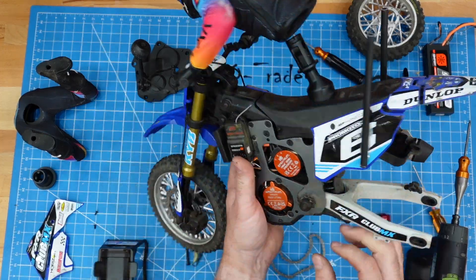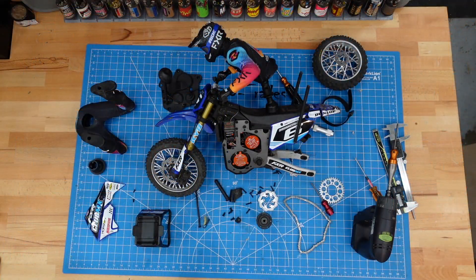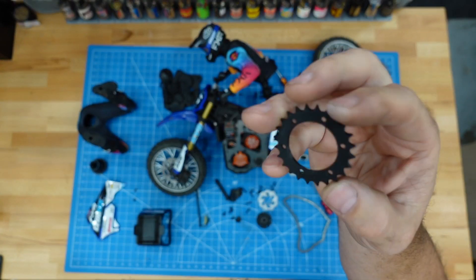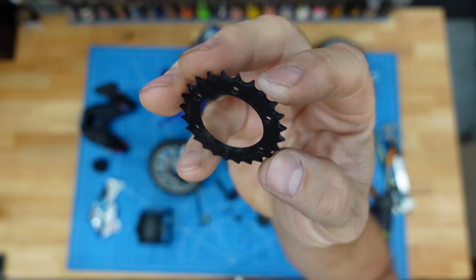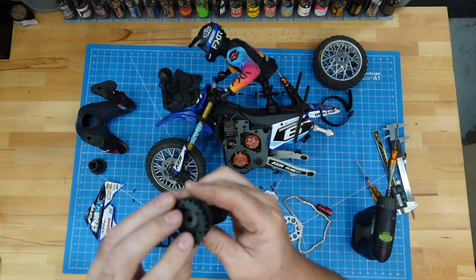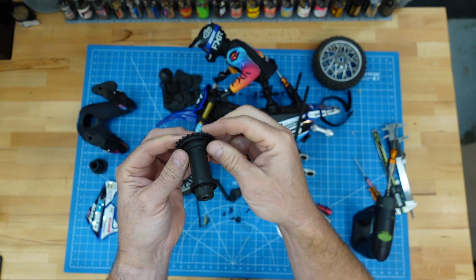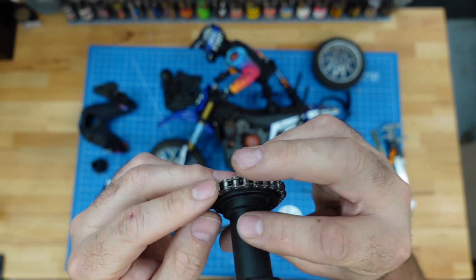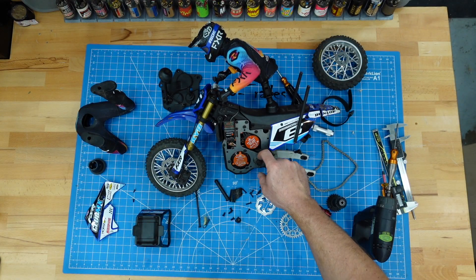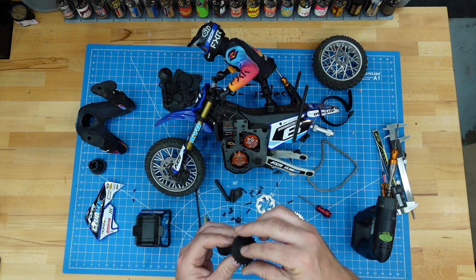Initially I'll try to 3D print one of these and then machine one out of aluminum. I went ahead and designed and printed my own custom sprocket. I'm not under the illusion this will last forever, but I think I can get some runs on it to see how it does. This is a 24-tooth sprocket going from a 36-tooth sprocket. The 24-tooth is probably the smallest you're going to be able to get with the current wheel hub design, because as you put that sprocket on, the chain will start dragging on the wheel hub if you go any smaller. You can also play around with larger front sprockets to get different ratios.